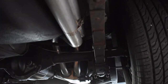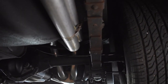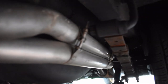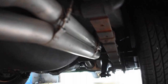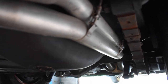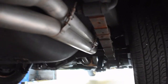Just don't do it — avoid it. It made lots of noise, it rattled, it banged on the pipes all the time. It's much better to hug the spare tire well vertically and give plenty of clearance to the leaf spring so you don't have to worry about any collisions between your pipes and your leaf spring, the axle, or anything else for that matter. That was the hard part.